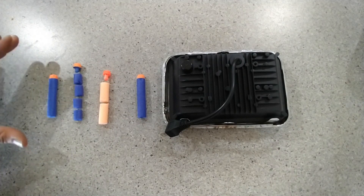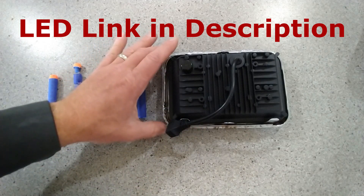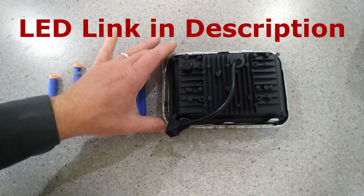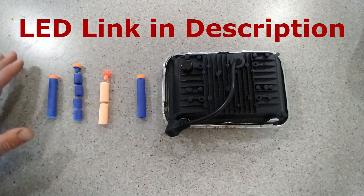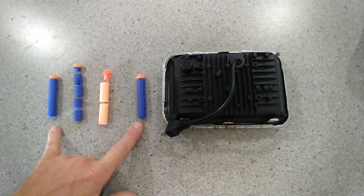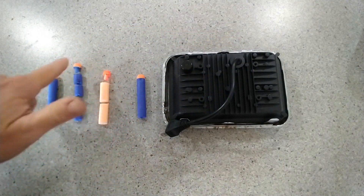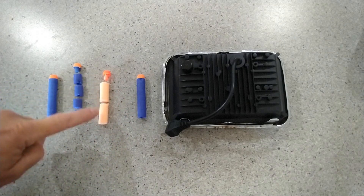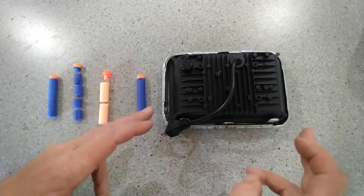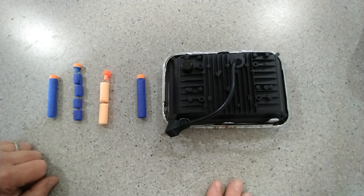This is the quick way of mounting an LED headlight into the 1982/1983 ATC 200 Honda three-wheeler. They don't have a really good mounting system, so what I came up with using things at home is nerf gun bullets as spacers. If you use four of them, cut them up like I have here and pull the tops out, you can easily get this thing centered, glued in, and make a vibration-free mount setup.